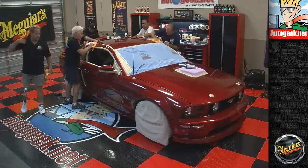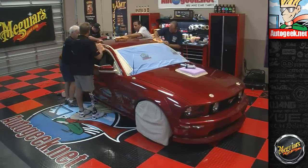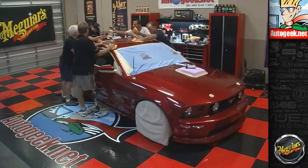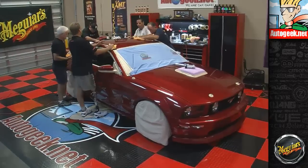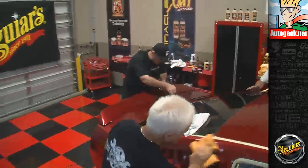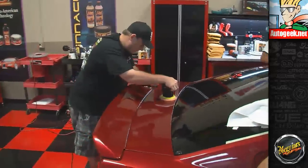How are we doing over here, Louie? You've got to work to get this off. That's one of the complaints, is sometimes it's kind of hard to get off. What I always do is mist on a little bit of final inspection. Spritz on the rag, it comes right off. Another thing you can do, if it's really bad, is hit it real quick with some fresh product, and then instead of working the product in, you use the product to remove itself. Like dissolves like is what that's called.